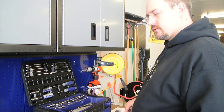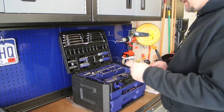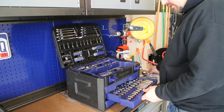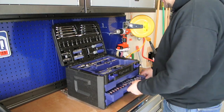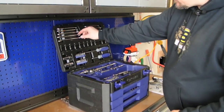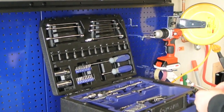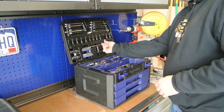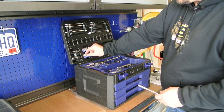For installation of the Trek Top Pro, you're going to need a sharp knife, a ratchet, and an extension will be helpful. You'll want to have a 10 millimeter and a 13 millimeter socket. I also recommend you have the same size wrenches to make it a little easier. The last few items you'll need will be a screwdriver with a 4 millimeter and Phillips tip.